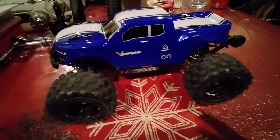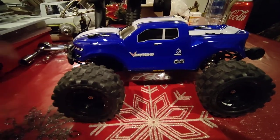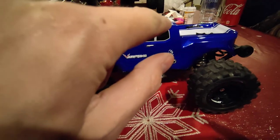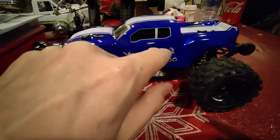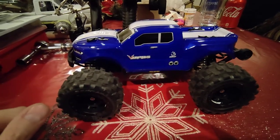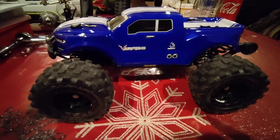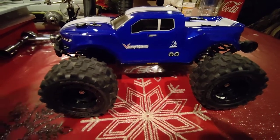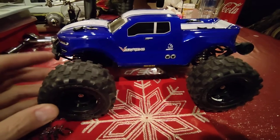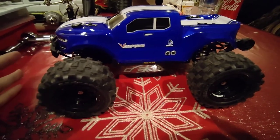That is my Volcano 16, and I will be looking into that pinion and spur gear deal and trying to get two pinions available for it — I'll probably go to Robinson Racing to get that figured out. If you're looking to do the brushless system, I would say look for a servo like the Savox 1250MG or find a servo of the same identical size.